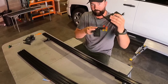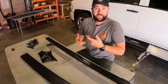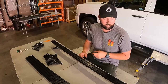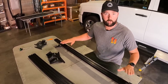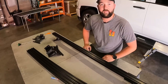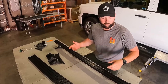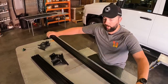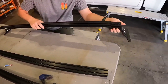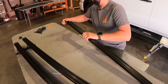I want to point out something about the feet: they're identical when held side by side, but when they go from driver to passenger they essentially flip — you'll have the clamp on one side of the load bar and the clamp on another side. All the bolts on the driver's side will face backwards, all the bolts on the passenger side will face forwards. This helps with manufacturing since we're only making one part, and it also stabilizes the bar and provides more strength to the system overall. Set up three of these total.